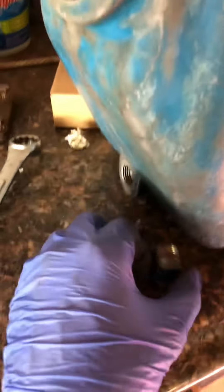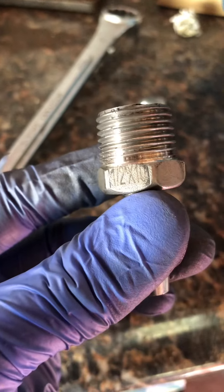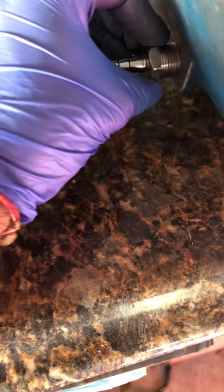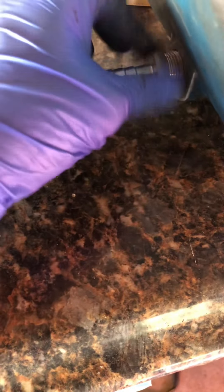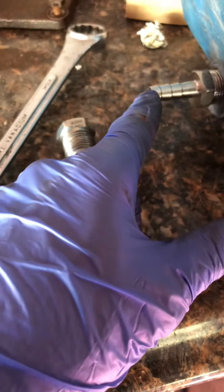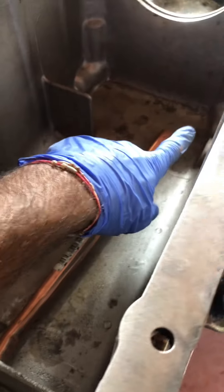Out front you've got a couple options — you could use a regular plug. But what I'm doing is putting a quarter inch nipple on there. This says one half by ten, but I'll put some RTV on there and screw it in, and that'll be an airtight fitting. So once I put suction on this, it'll take the oil out — I don't have to fish a smaller tube all the way down this tube to the back.